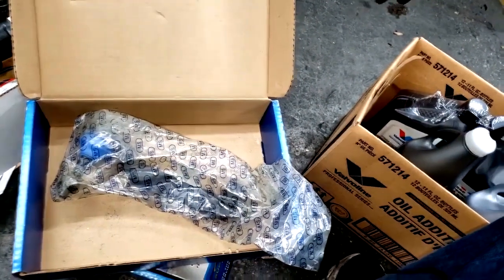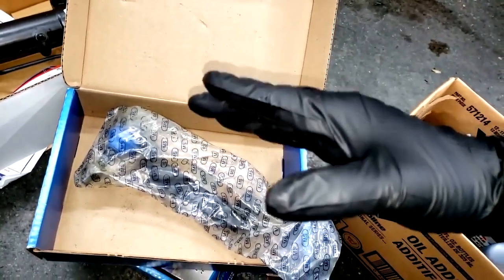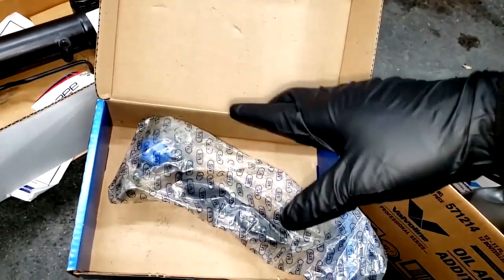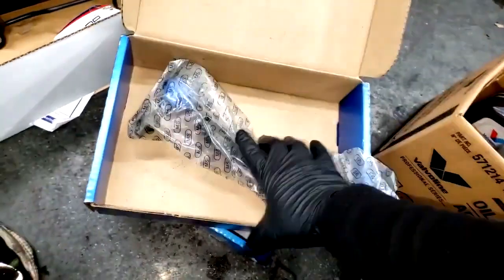This car's got a lot of miles on it so it needs some maintenance. Also, I need two tires because when you ride with a bent tie rod it affects toe, and toe was way off. She just kept driving like that - she even drove it to the shop like that - so you can imagine how much toe wear accumulated on those tires.